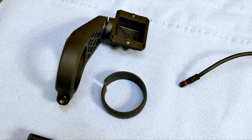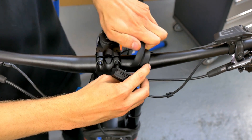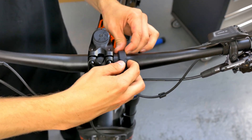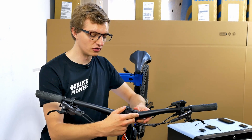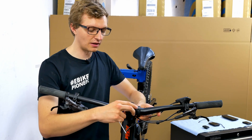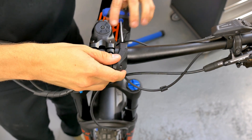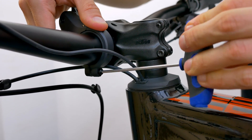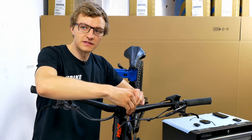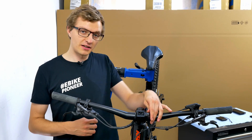Now we first have to position the one arm holder. As mentioned earlier, we decided to mount it on the left side of the handlebar. Simply wrap it around the handlebar. Insert the corresponding spacer rubber under the one arm holder, then you can close the clamp. It is now reasonably tight. You have the possibility to fine-tune it — for example, how close you want it to be to the stem. Then you can tighten it with a 3 mm Allen key at the corresponding screw. The recommendation is not to tighten it completely at first, to ensure that you still have a bit of clearance to move it. Once the display is mounted later on, you are still able to position it in the way that is best for you while riding, so that you have all the relevant data in view.